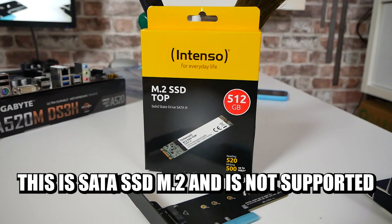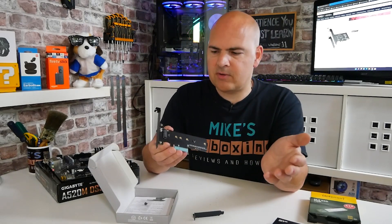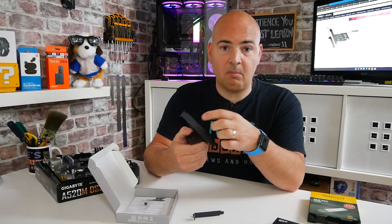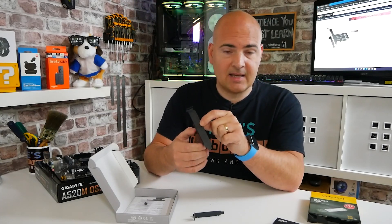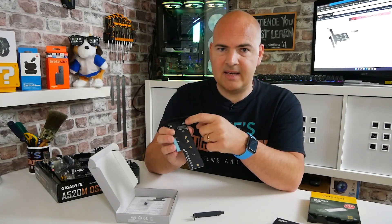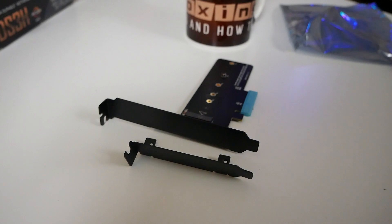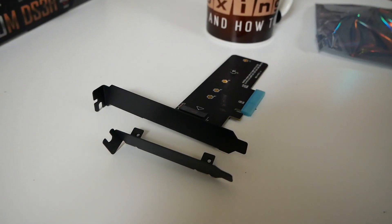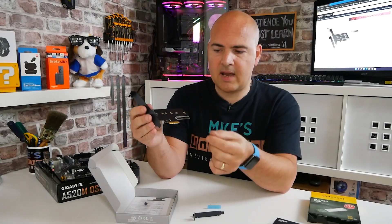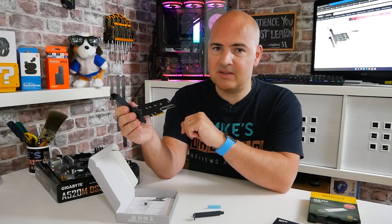As long as your drive is an NVMe or M.2 PCI Express drive, you should be absolutely fine. If you've got any questions, feel free to let me know in the comments section below. Going back to the card itself, in the description on Amazon they often show it with some LEDs on the back - a power-on LED and a drive activity LED. On this particular version it's been switched to the inner side. We've also got this blue protective cover over the PCI Express fingers - you can just pull that off to expose the gold contacts. Most of you are probably thinking this will go into a PCI Express x1 slot, so let's try that now.